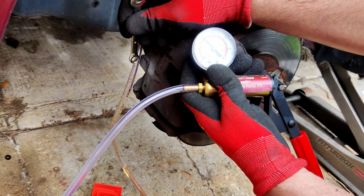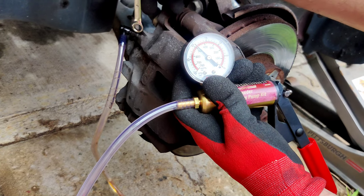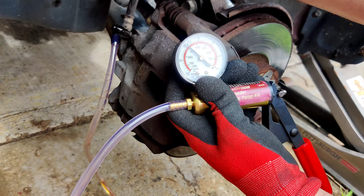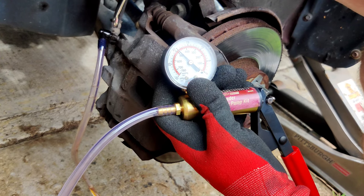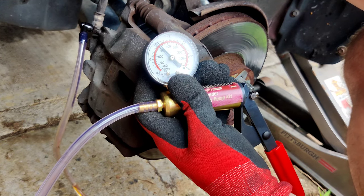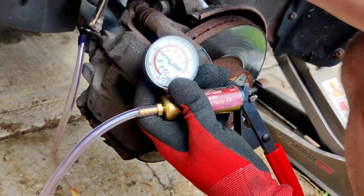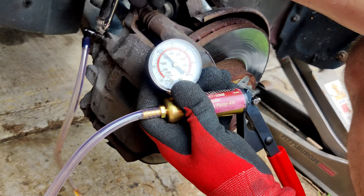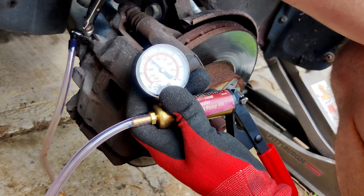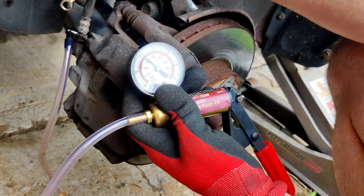The other thing is, if you barely have any flow — maybe just these types of bubbles flowing through — when it looks like that, whether or not you're doing the thread sealant, you have to get into the car and push the brake pedal down once, twice, maybe three times, all the way to the floor with this nipple open, this attached, and vacuum on here. Leave the vacuum, open this up, push the brake all the way to the floor if you're doing a one-man job, because that means there may be a clog in here. Most likely it's going to be this little nipple here. Once you push that out, you'll clear it and you'll see a regular steady flow. A lot of people have trouble with these because the suction can't get past the clog right here. So you could take this off and try clearing it, or again just shove the brake pedal all the way down to the floor.